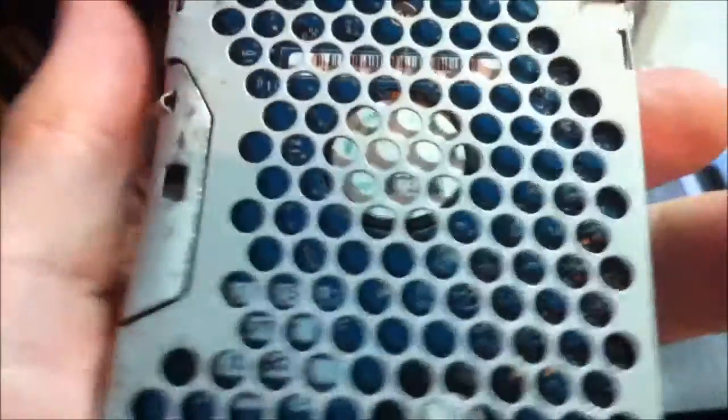You can see that little bump at the bottom there — that's going to stop your hard drive going in nicely, but you can get around it. I've got my hard drive in the caddy. When you do this you have to make sure the hard drive does not touch anywhere underneath, which you can see it doesn't. It's perfectly good, and then it's a simple matter of slot it in.